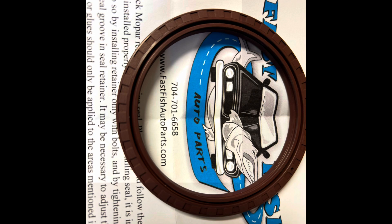Before we do that, I have to mention that last video I put the rear main seal in this thing backwards. It is a Fast Fish seal — fastfishautoparts.com. Jeff's agreed to do a Just Mopar Joe discount, and that's from now until forever, not just a Christmas thing. I put the seal in backwards — it's a double lip seal and they have a certain side marked. I wasn't paying attention and I rolled it right in. It doesn't leak, so if it makes it through the dyno test, I'm going to leave it alone.